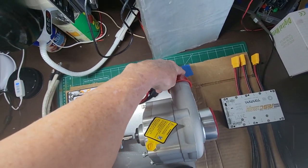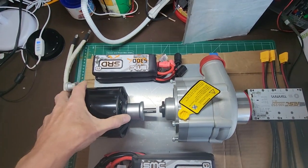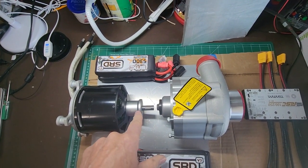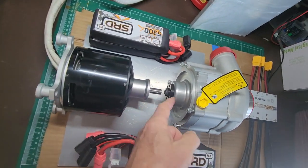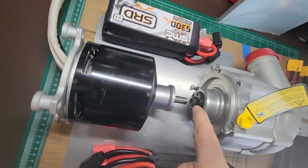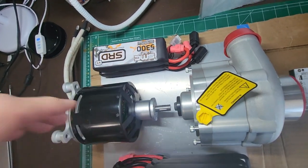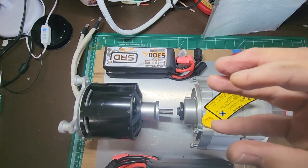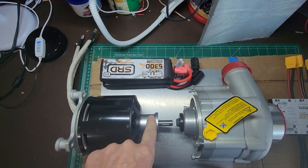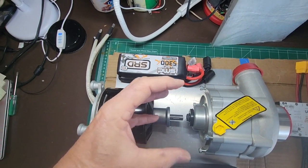This will shoot out through a hole in that motor well, go under the car as the charge piping. I plan to direct drive this thing. I'm probably going to put some studs sticking out here — six of them — and make an aluminum piece with six holes in it so that those studs slide into the holes and lock them together with a little bit of play.